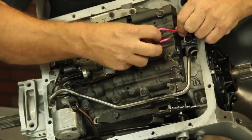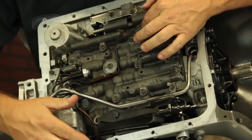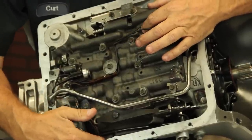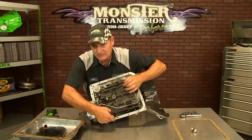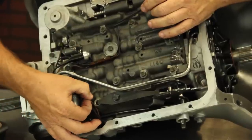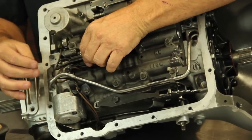There's a hot lead — the red wire is hot, and it usually goes to a brown wire. The brown wire stays factory and goes all the way to the case connector where the power comes in from the vehicle. There's also sometimes a tan wire, or even yellow — that wire is not being used, so you can either cut it off or just leave it alone.